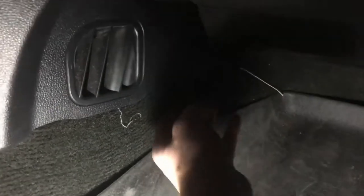To run your power wire, I've got it plugged in right here and run along the side so you can still close this. I ran this wire right inside that crack, then you can pull this panel off back here — grab hold of it and it just pops right off. Grab the wire from about here where it's sitting, pull it all the way through, and run it up behind this, all the way along there, and then up inside of here along the side. Now we'll put this back on the front and all our wires are ran.